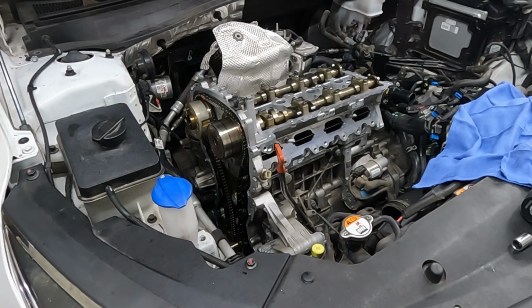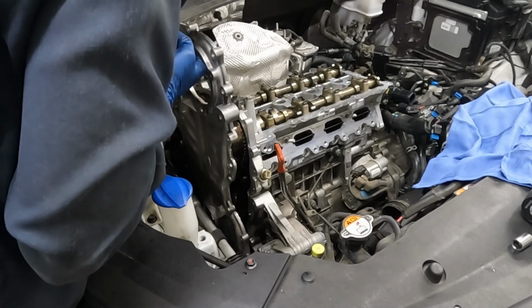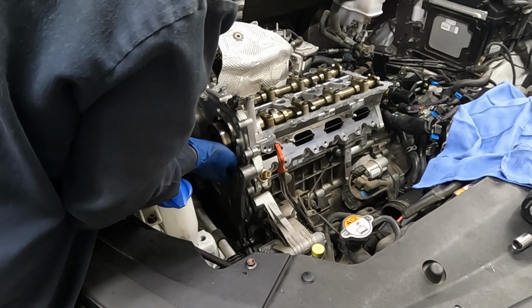Okay, down below. Now in the corner where the oil pan meets the block, the corner of that oil pan, we wanna put a bead right in the corner. If you have the crank bolt on because you were spinning the engine, we wanna pop that off first. Okay, let's feed this in and try not to get that RTV on anything. Just straight down. Perfect, just like that.